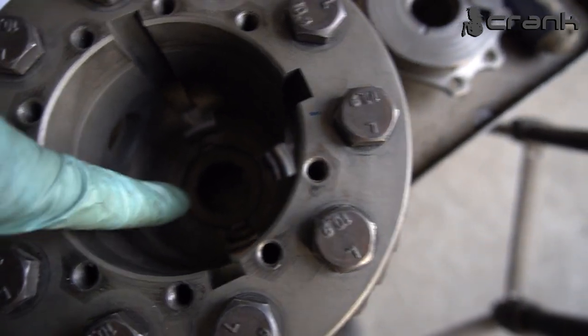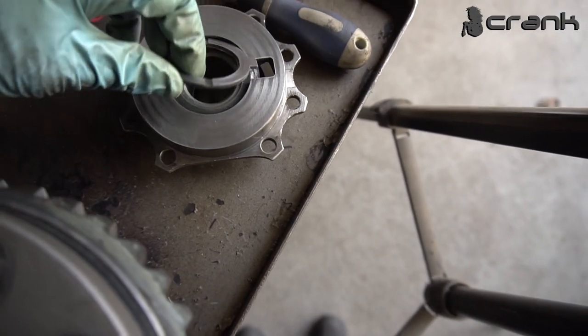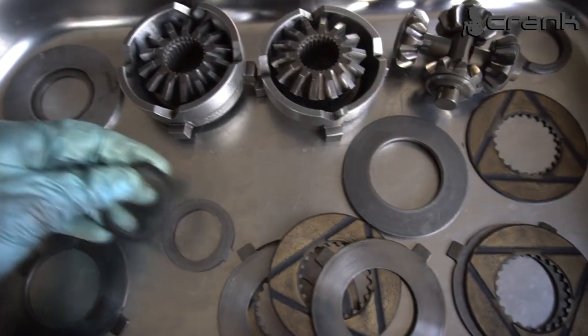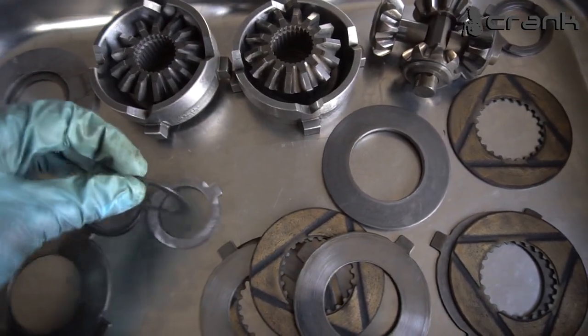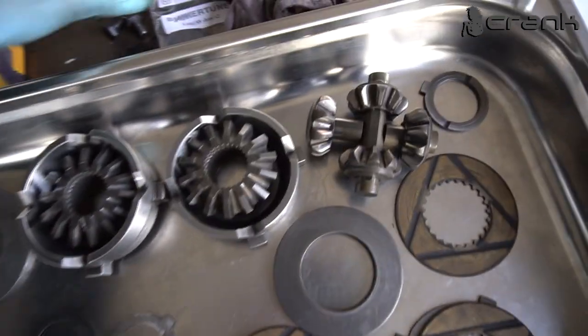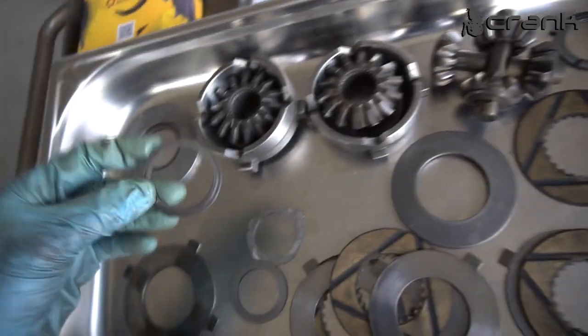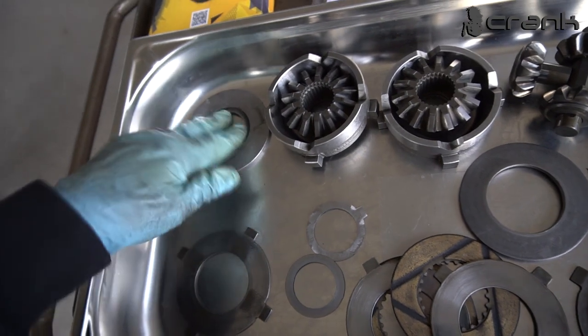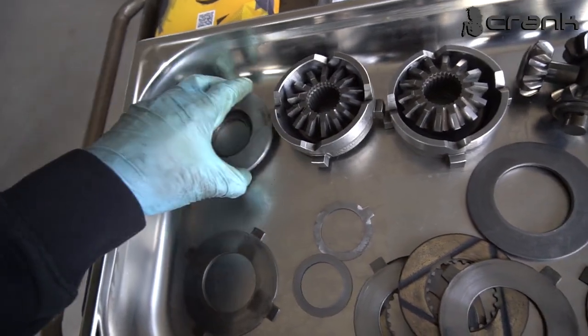The same goes for the bottom of the casing. They should be installed the same way as here. But in my case, I had only two of them. Not sure why the previous builder decided to make it like that. Probably I'm going to use only the thinner shim once again, plus the oil shim which I bought from Beamer Tune. I'm not going to be able to use the thicker shim because I probably won't have enough space, but there's nothing I can do about it.